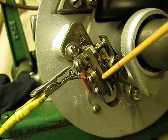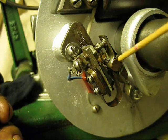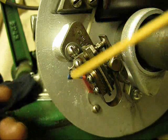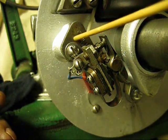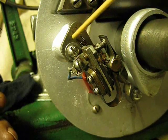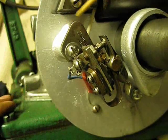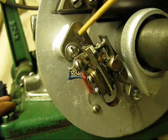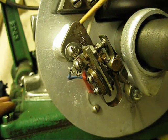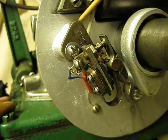From experience, you do want these fibers to be really, really clean and dry. Moisture will ground out this system also. Good maintenance is a necessity. On this particular set of points, the backing plate — the fixed plate — has a pin fixed to the point plate, and those two match up. On this type, you do not need a point setting tool. The backing plate that does not have the pins, you have to use a tool that fits in this area and aligns the backing plate. Once you have aligned that backing plate, if you do not loosen these screws, that adjustment remains constant. You can remove the points without removing the back plate by just removing these two screws. Once it is set, maintain that setting.